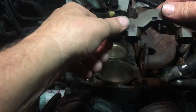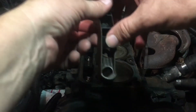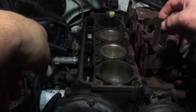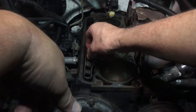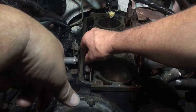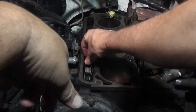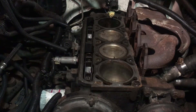Now, the retainer is flat on one side and bulged on the other side, and you can see that there's a similar cutout in the way that the block is cast here. So when you put this down over it, if you've got all those things aligned correctly, you will feel this thing just drop down into place as it goes over each one of those lifters.